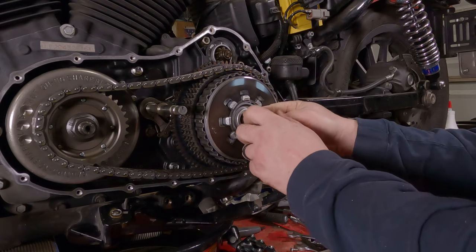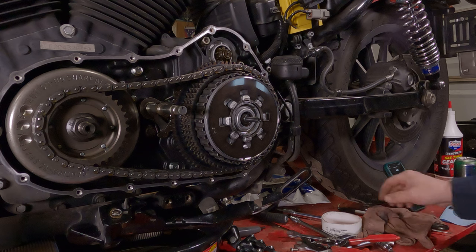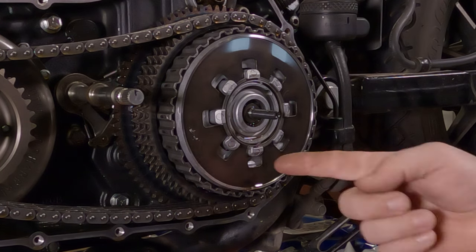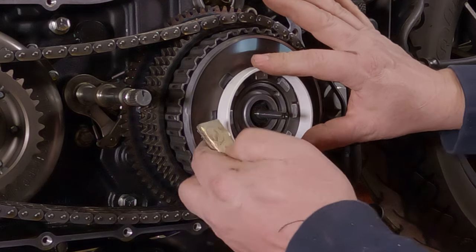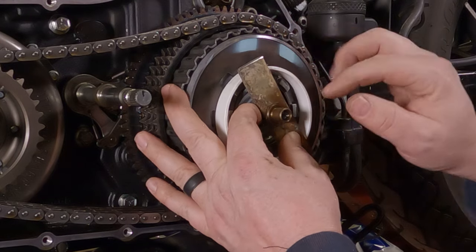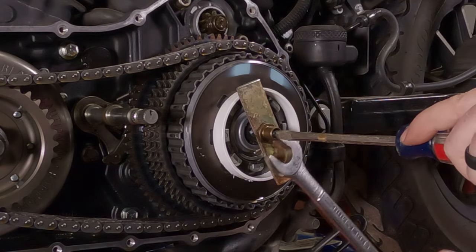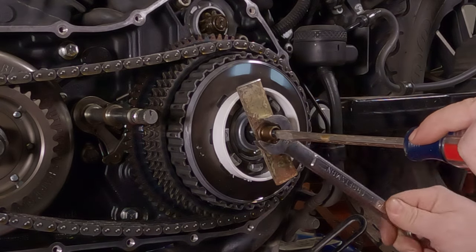You have this little hex spring nut — whatever we want to call it — the nut that the spring goes over top of. This was part of your clutch; it's the same thread as the shaft. We're going to use that as our jack bolt. Our goal is to take off the outer snap ring — we're going to push this pressure plate in, then take this snap ring and flick it up. Take your now-shortened PVC disc, your little metal spanner, and this nut, and thread it up on there. Tighten it up until it all seats. Take a Phillips-head screwdriver and a three-quarter-inch wrench and tighten it up — this won't take a lot of force. I'm just trying to compress that spring as if you were pulling in the clutch.